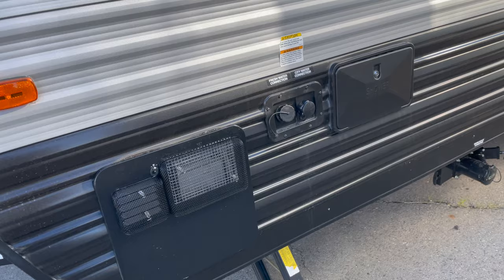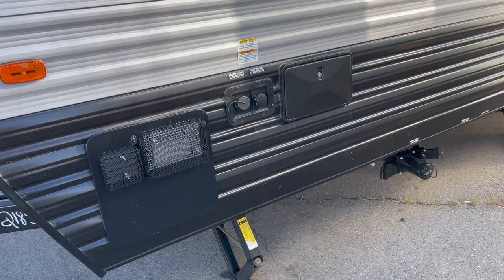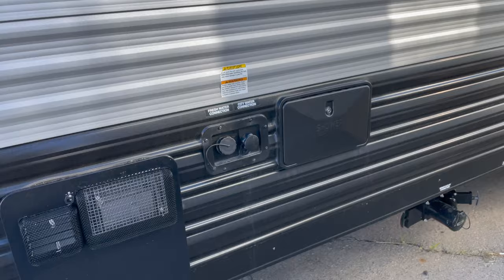What was happening is that elbow is located slightly below the top of the tank, so there's no way you're going to be able to fill your tank up full each time. So I went in and finished the installation from Forest River, running a half-inch ID vinyl tube from that vent on the tank up into the trailer and attaching it to the backside of this screen. So now I have a proper vent.